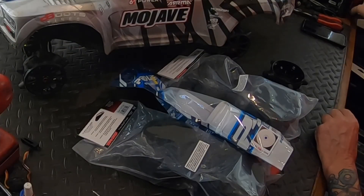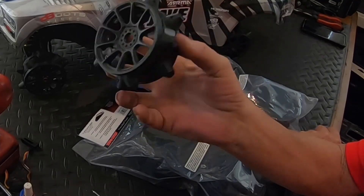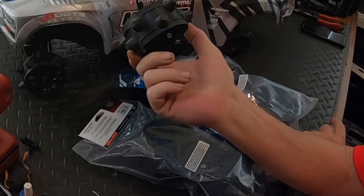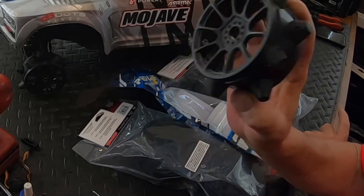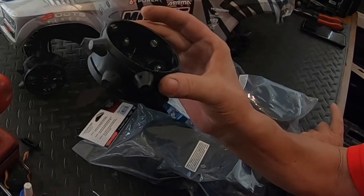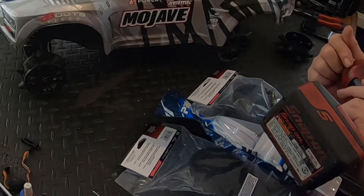I'd love to say my cleats failed, but the rim failed. How can we solve that? We can go to an aluminum rim — it's going to be very costly — put some spikes on that, and I don't think the hexes will strip anymore. We might start busting some axles, but we're having pretty good slippage with this. I have soft start set up, haven't adjusted torque limiting yet, which I might have to do. But these were used rims anyway — not only used, I had to boil them for 15 minutes each to get the tires off, which I showed, and that also could have contributed to softening up the plastic.